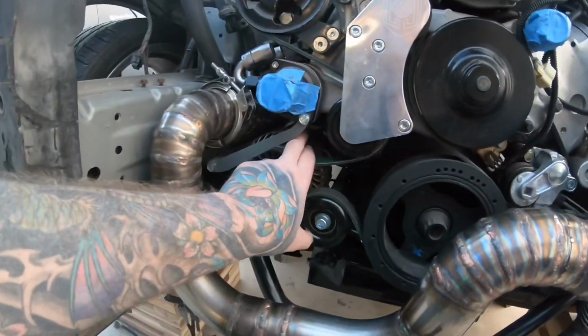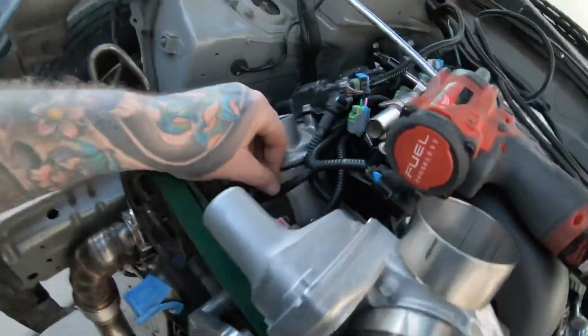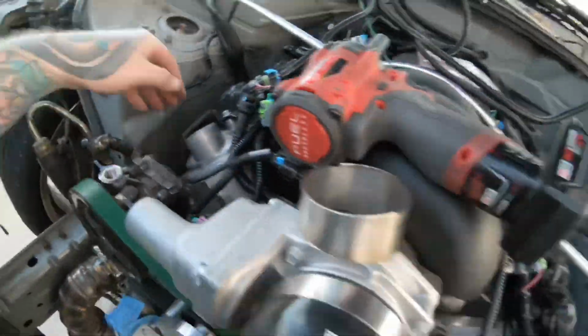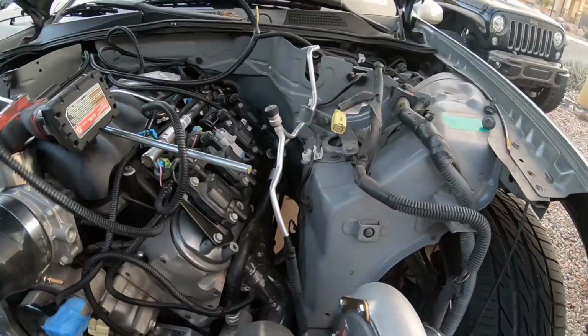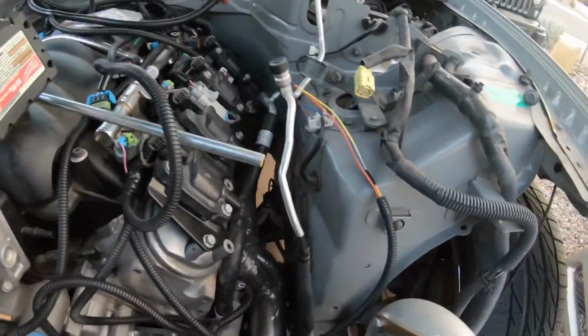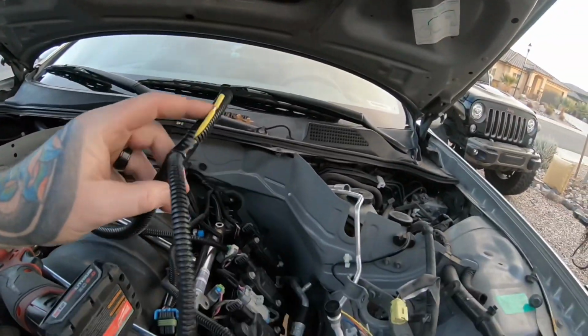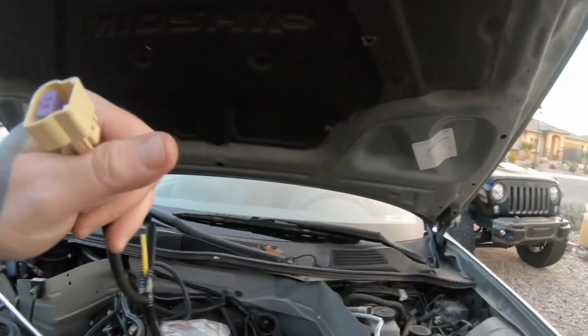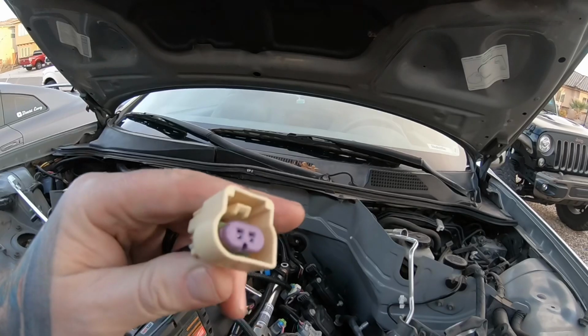Anyways, like I was saying, I was gonna make this video short. Just wanted to get one final one in before I left town for 2 weeks. I did get the alternator wired up last night. Ran that wire down, tied it in, made sure it was gonna stay away from the exhaust manifold there. This one goes down to the AC. I've got the connections in there, and then this one goes down to the starter, and I believe that's for an O2.